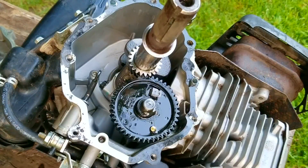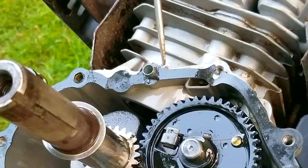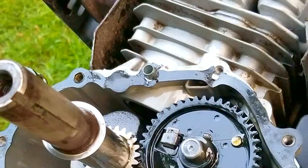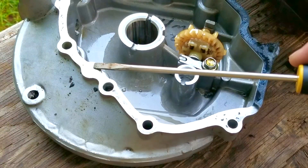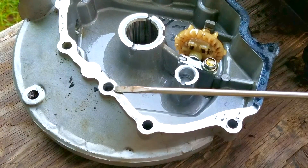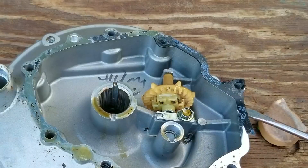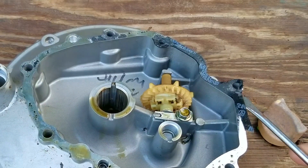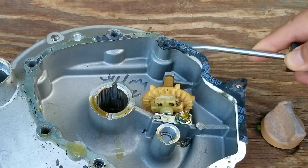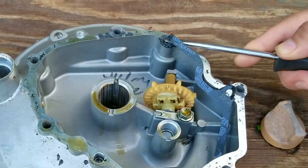The gasket is in pretty rough shape. The leak is around this area — looking at the sump, the leak was basically between this blank area and this hole. There's nothing wrong with the casting of the metal and none of the bolts were loose, so the gasket simply failed. If I replace the gasket it should stop the leak, and the first step is to remove the old one. There are a few places where the gasket was stuck to the metal and we need to make sure we get as much off as we can.